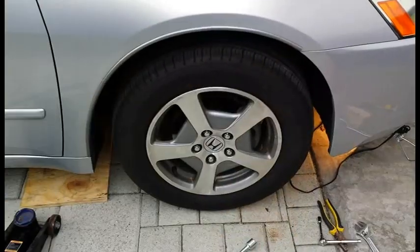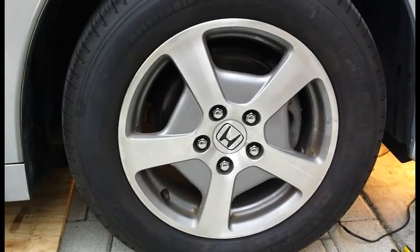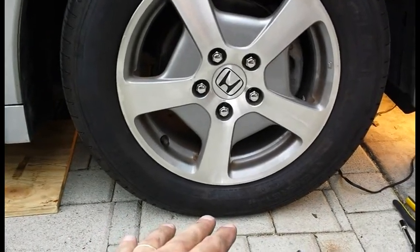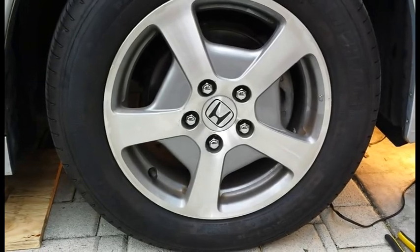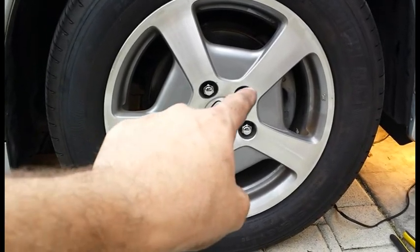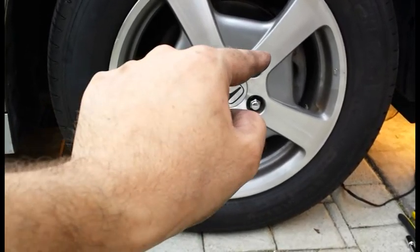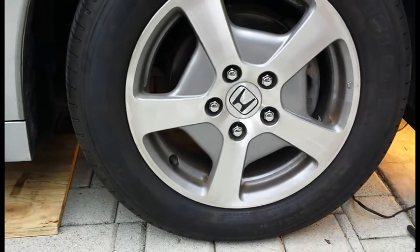When you're putting the wheel back on while the car's still lifted, put all the nuts back on and hand tighten them so the wheel is flush and flat against the hub. Then lower the car a little bit just so the tire starts touching the ground and has a little pressure on it — that's when you go in and really tighten them as tight as they can go. When tightening, start with one lug, then tighten the one opposite, then opposite again, and so on. Do not tighten one bolt at a time — always tighten the one that's opposite. Once they're all tightened, put the car down and go for a test drive.